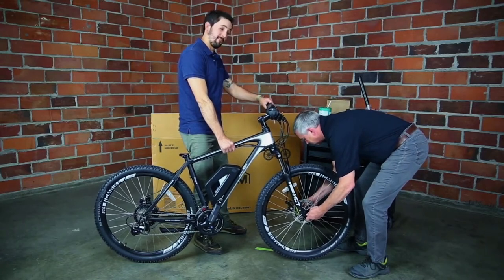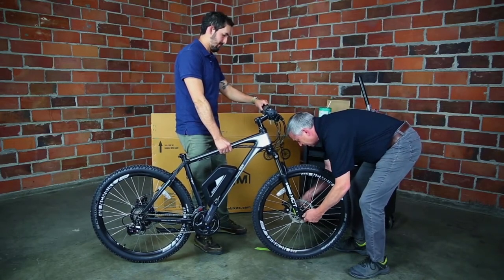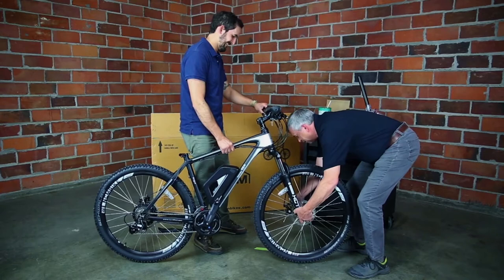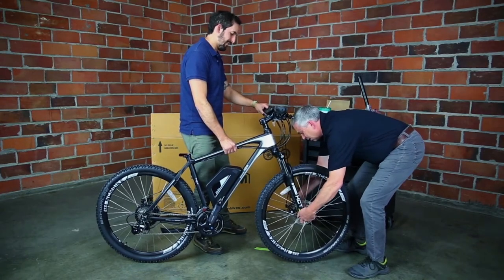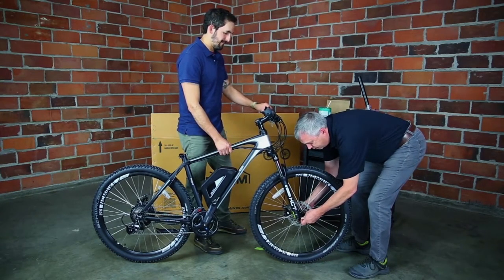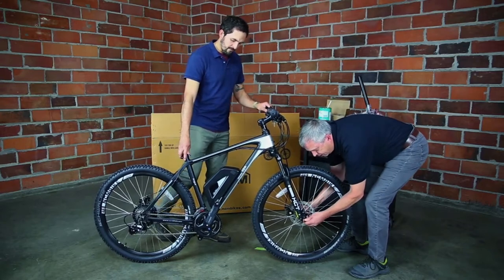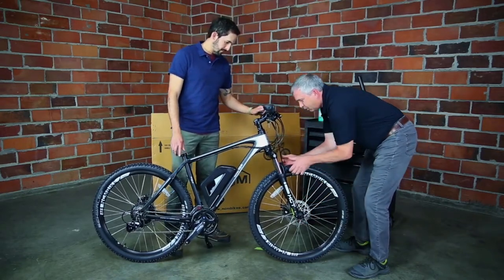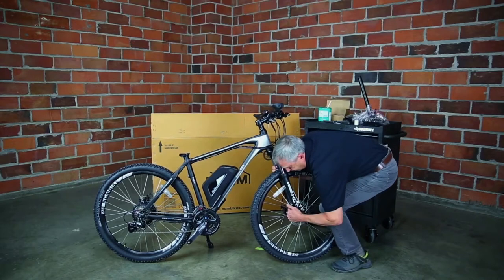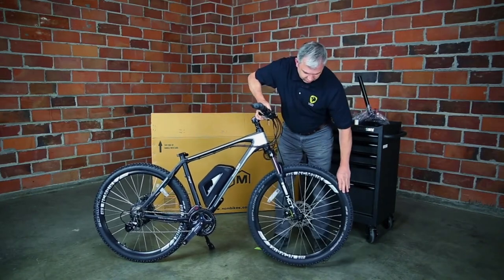This is Enrique, by the way — he's also the cameraman. We just got to tighten the hand knob up until the quick release lever starts to grab at about halfway through the throw. Then make sure the wheel is centered up in the forks before you tighten it all the way down — that's going to help everything run smooth. Give it a spin and make sure the brake rotor is not rubbing on the brake pads.